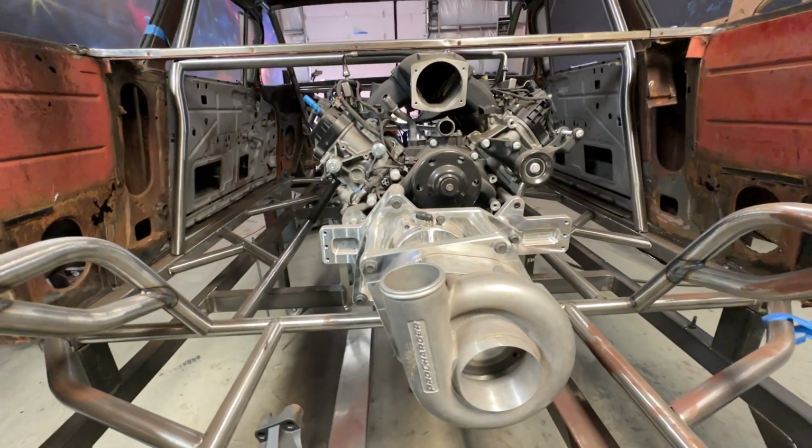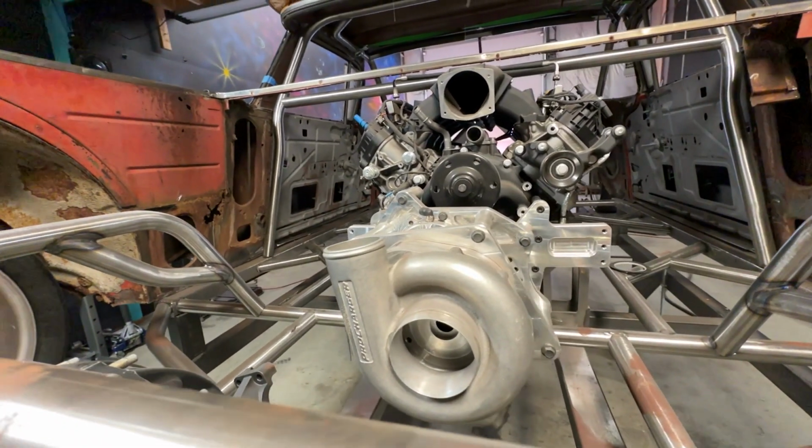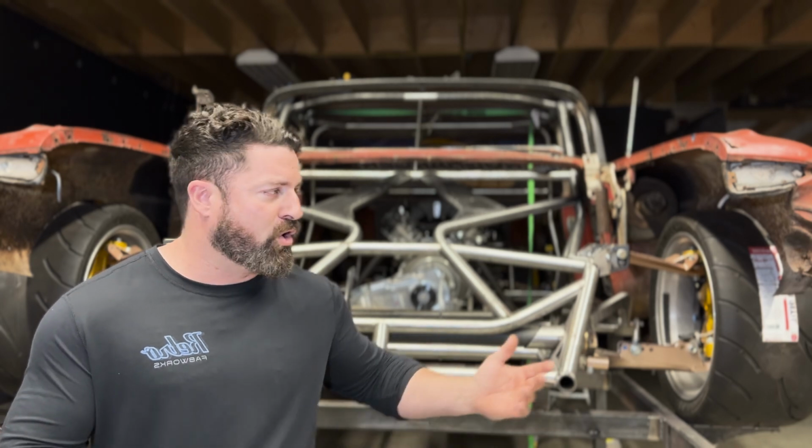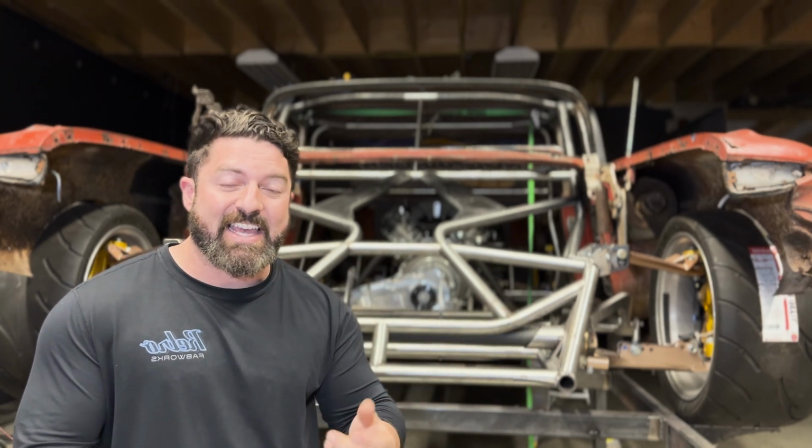But the whole idea is this. You guys have seen it. Ford Godzilla, Pro Charger, crank driven. The reason I went into that whole system is I wanted instantaneous boost with a big cubic inch motor for the all-wheel drive system. Whole idea is I'm going to do a lot of street driving with this. The car can come up on boost instantly, and I have an automatic with a torque converter. I can flash this thing instantly, and with the all-wheel drive, it's going to be ultra violent.